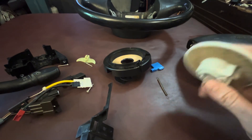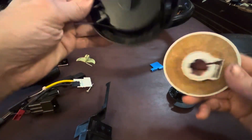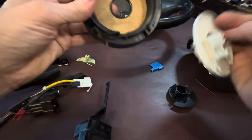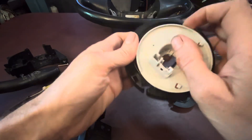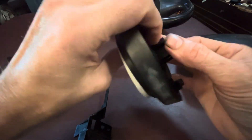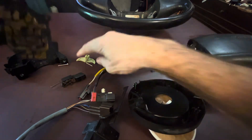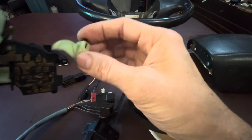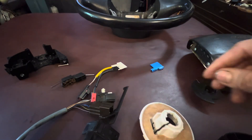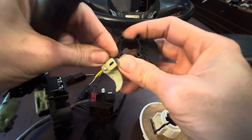Let's start off with the problem with the horn and the airbag. This is going to be in what's known as the airbag clock spring. As you can see, it's got a couple of pieces here. This piece is fixed to the column and snaps on through these little clips. This piece goes with the steering wheel, and this goes on the back side, which snaps it together. And this is what controls the turn signal switch. There's this little thing here called a canceling finger or arm, and it rocks back and forth and rubs up against this little centerpiece, which is right here.